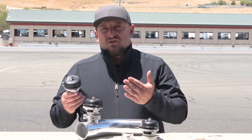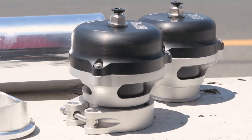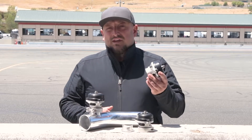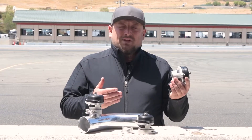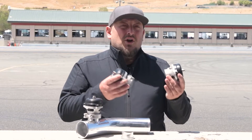It's designed for serious boost and for serious horsepower — this blow-off valve is ready for whatever you throw at it. If you think that one blow-off valve isn't enough for your application, we do have a lot of people that run two blow-off valves on either twin-charged or high-horsepower setups. The Nuke Performance blow-off valve is delivered with its most popular setup for 0.35 to 0.5 bars of boost — that's 5 to 7 psi. Two other springs are available from as low as 0.35 and all the way up to 0.75 bar.